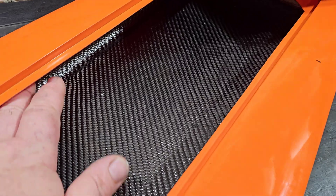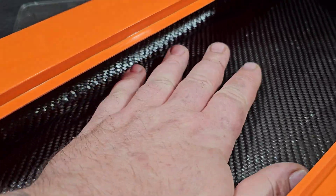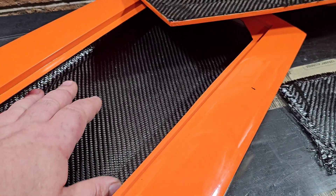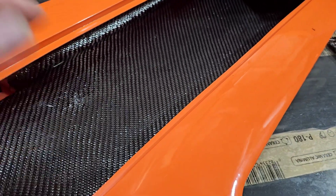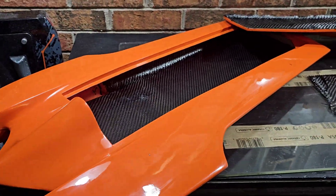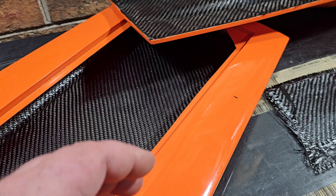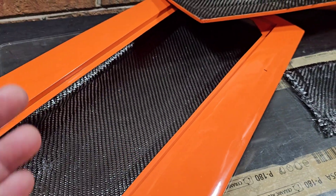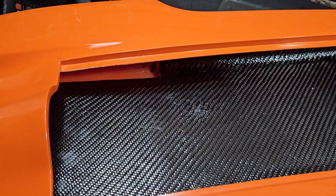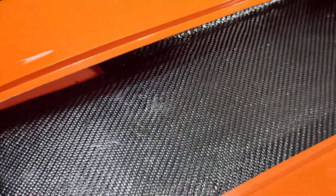I upload videos and content daily at 7 a.m. — just a boat channel. We build boats, run boats, break boats. The inlay turned out really good. After the fact I was like, man, why didn't I just stop it right here and only do the carbon fiber inlay where I'm going to put my electronics, because really that's all that needs to be supported by the carbon fiber. So if you're doing a hydroplane build, consider masking off maybe the back quarter of the boat to reduce the weight you put back there.